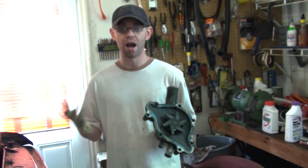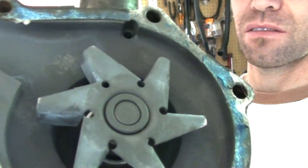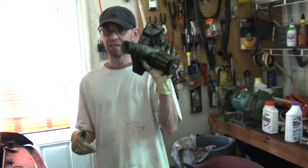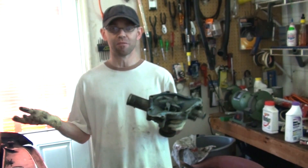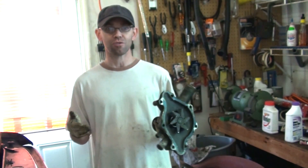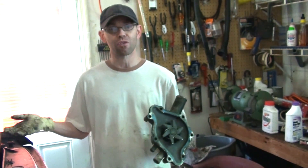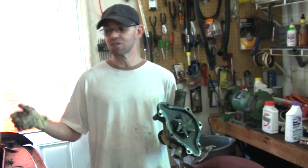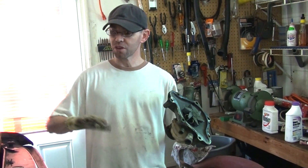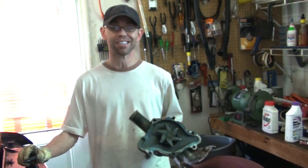You may be asking yourself, why would I want to replace my water pump? Well, if you listen to this sound, that's a good indication your water pump needs to be replaced because it's not supposed to make a sound like that. You may not be able to hear that sound over your engine, so it might take a trained professional to figure out if your water pump needs to be replaced. I've had this truck for quite a while and I started noticing a hum I hadn't heard before, so by process of elimination — taking a couple belts off and figuring out where the hum was coming from — I was able to determine that my water pump indeed needed to be replaced.